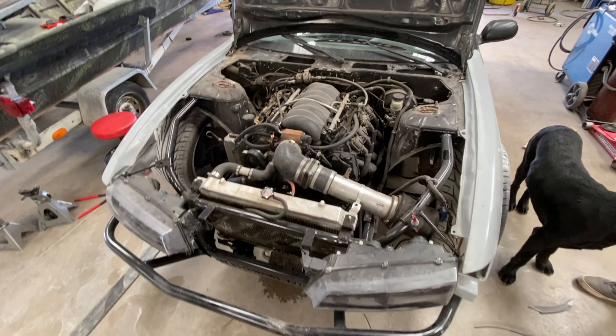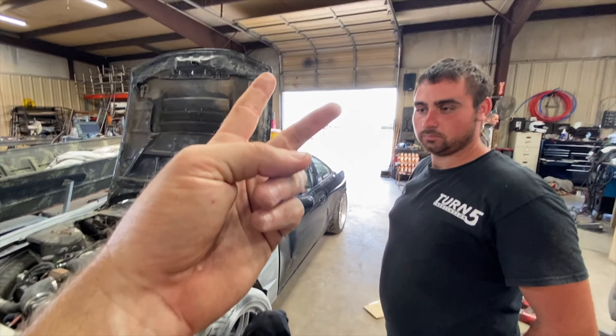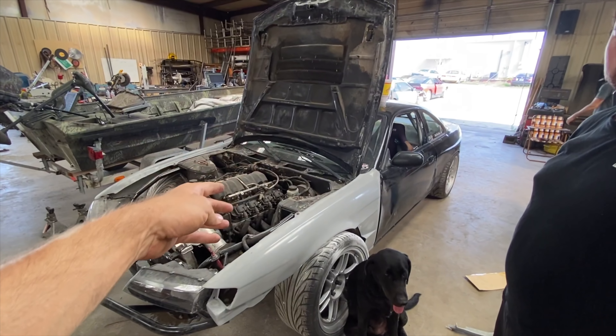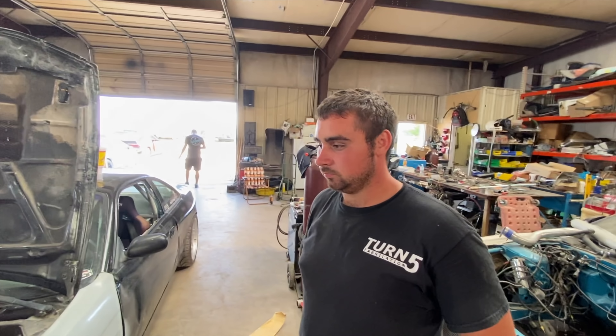The only problem with chasing everything around too much with arms is then to get correct alignment, the arm layout isn't symmetrical. So it kind of starts to become chasing a mess and you don't want to do that too much. I'm not really great at crazy alignments or anything, but I love this car. My friend Mark has been trying to get me to throw this chassis away and do another one — and he's probably right, except it is so much work to change a chassis. We'd have to build a new cage, redo the body work, strip everything, bang out the firewall, move the entire drivetrain over, realign it, repaint it — this thing does need a paint job — but it's just so much work.